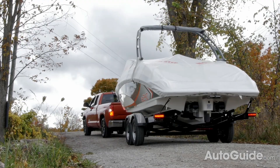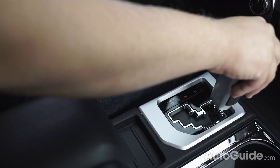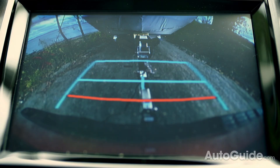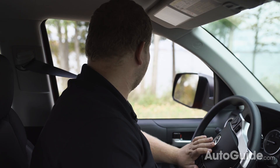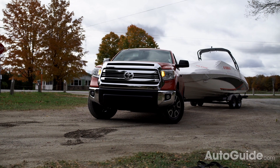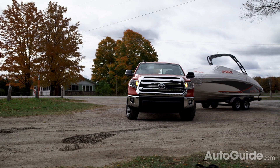Once back in your truck, use a combination of the mirrors, backup camera, and checking over your shoulder to make sure the trailer is going where you want it to go. The first move in reversing, which we'll call the cut, sets up the trailer on the proper angle. Then the second move, which is when you follow the trailer, continues the turn while bringing the vehicle's wheels back in line with the trailer's wheels.